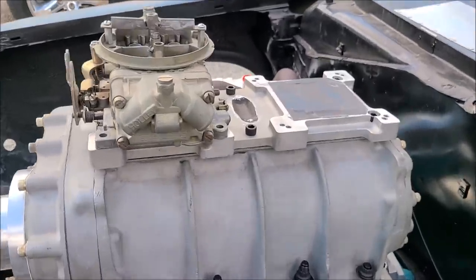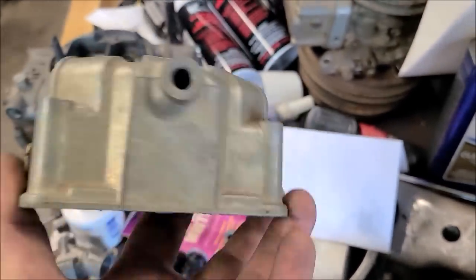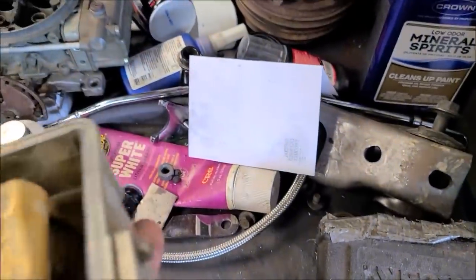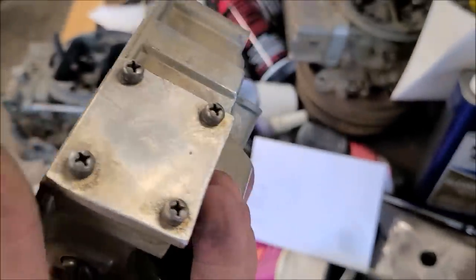Everything looks pretty good. I changed out the rear float bowl. The dude I got these from was very knowledgeable in Holley carburetors, so I'm not doubting his deal, but when he put these center hung style slash cathedral bowls on here, he made this block off plate because these are off a double pumper, and on a double pumper, that well is opened up. Yeah, these are kind of dirty inside. Carburetors were clean, but he made a gasket and he said this worked.